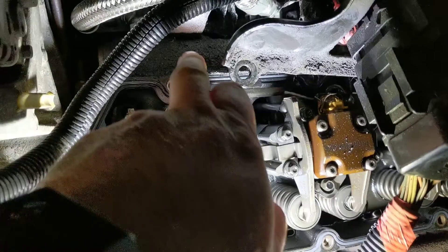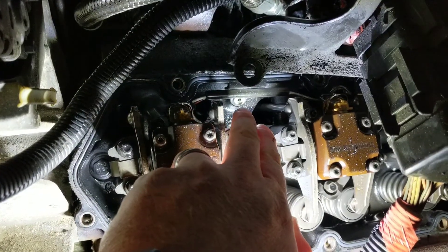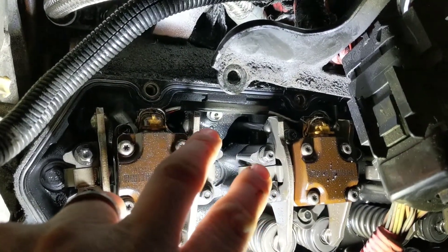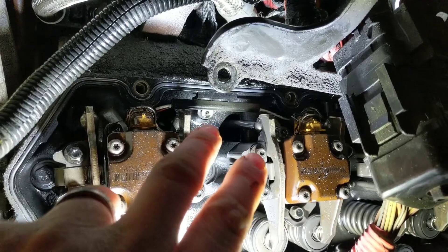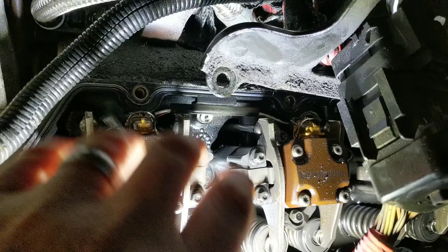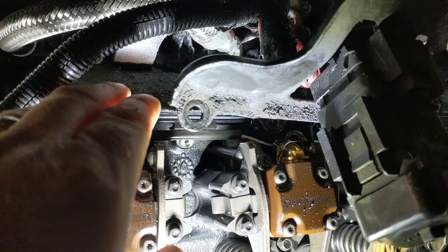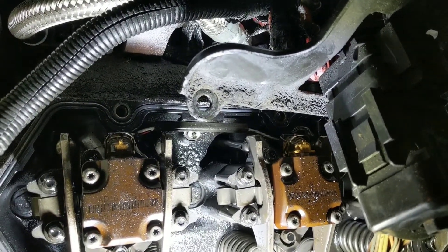There is an oil reservoir on top, and you're going to pull the plug out. There's a plug here and a plug down here — they're basically just a one-eighth Allen. Those are really tight, so use a socket-based Allen with a decent ratchet. If two plugs come out that's sometimes enough to drain them, but sometimes you need to pull one of the high-pressure lines off the top so air can get in. If you don't drain these, the oil will fall into the injector holes and fill up your cylinders — you really don't want that.